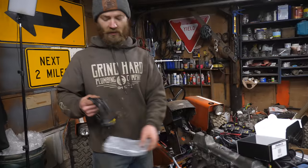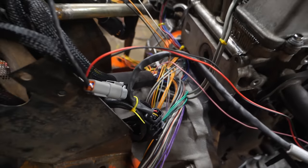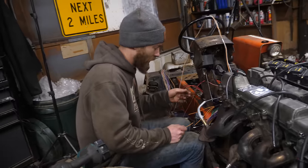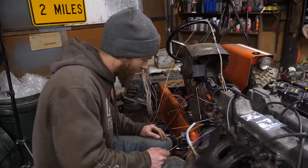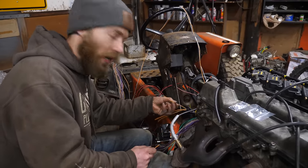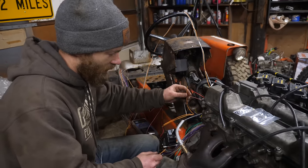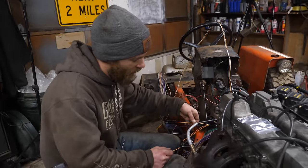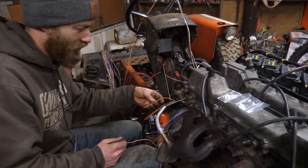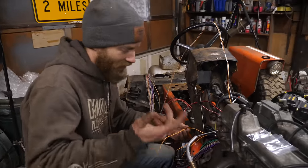Here's the wideband controller that talks to the ECU. I'm also wiring in the accelerator pedal, which is pretty exciting. From the wiring diagrams it needs two 5-volt signal wires and two sensor ground wires. Rather than cut the end and splice another piece on to go into the pin-out, I just made a slit in the sheathing and split it down a little bit so now we've got two. I'm sure that's how it's supposed to be done — I've never done it before so it's exciting.